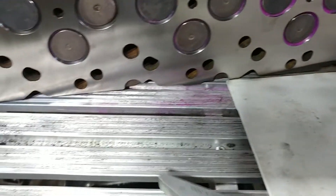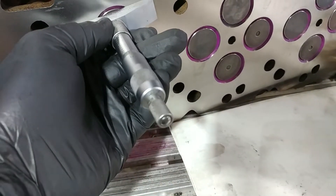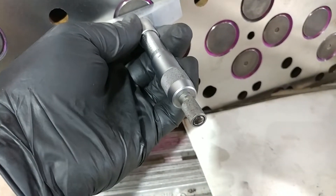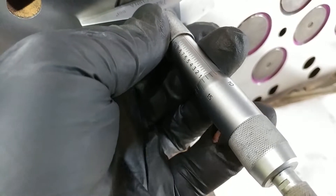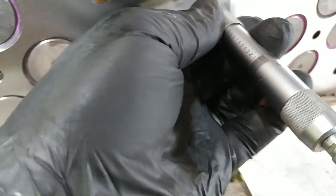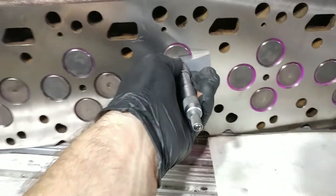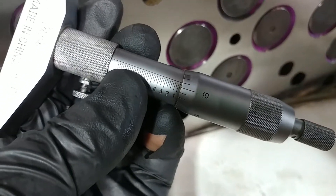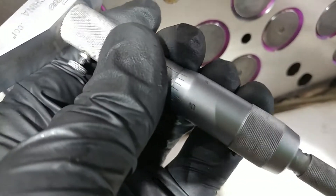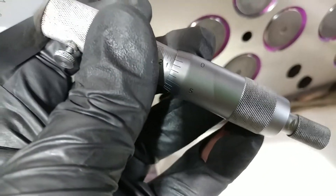Let me go ahead and roll it back. We place it flush against the cylinder head — this is incredibly difficult one-handed — and roll it till it stops. I know from using this that we just passed 50 thousandths and we're coming up on 75, and that feels like it just bottomed out. So that's the number four cylinder — we'd say it just bottomed out at about 59 thousandths.